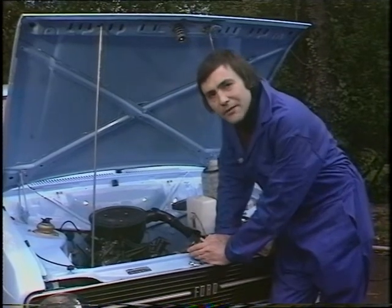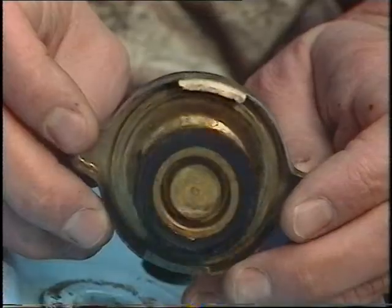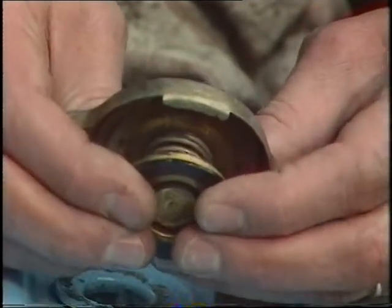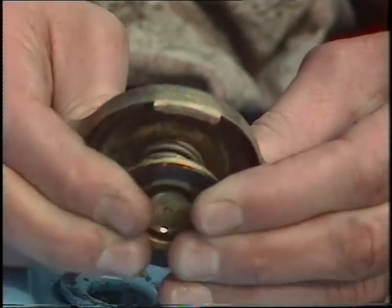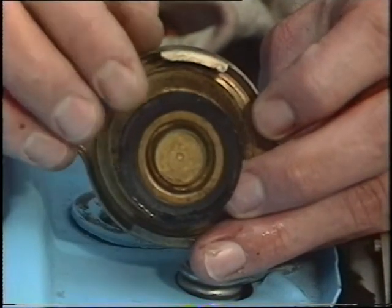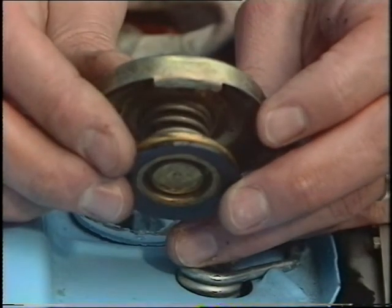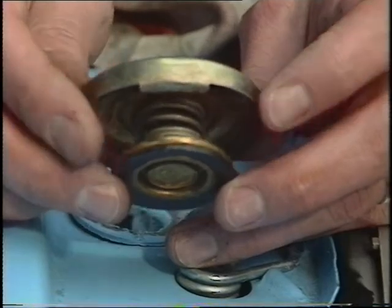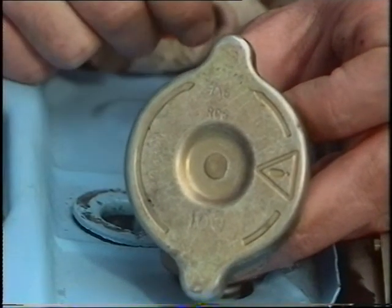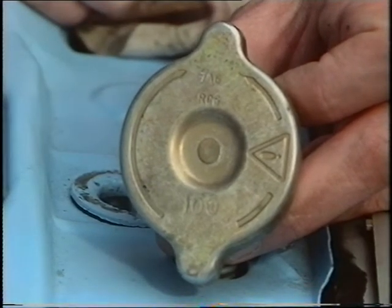But why have you lost coolant in the first place? Well, let's examine the radiator cap — this is quite a sophisticated piece of machinery, and like all bits of machinery it wears out. Radiator caps are designed to hold the system under a certain pressure, which is why they have a spring in them. With age that spring can become soft and worn, and equally the rubber seal may have perished. If so, change the cap — but not just for any old cap. Use a cap with the same numbers on it as are on the cap presently on your car, because every water-cooled system runs at a different pressure.